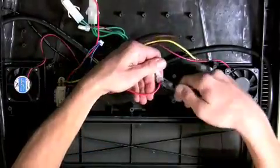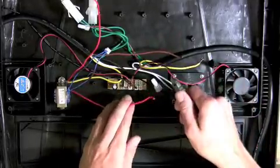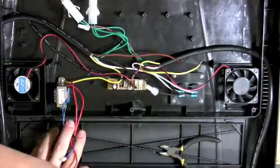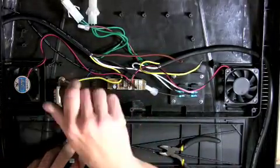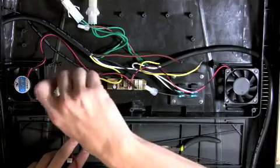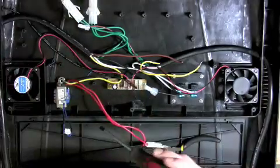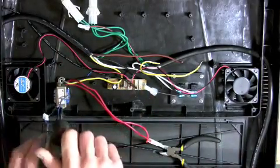Using a pair of wire cutters, cut the red wire from the closed-end connector holding the 2 black wires and the red wire in place. Using a Phillips head screwdriver, remove the 2 screws holding the transformer in place. Once the screws have been removed, remove the transformer and discard.